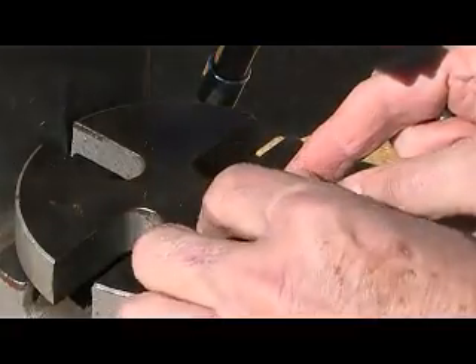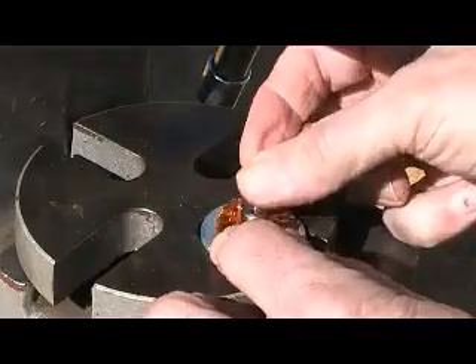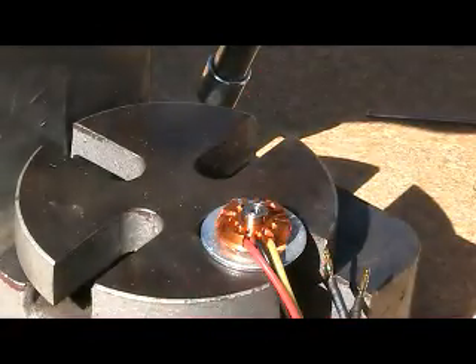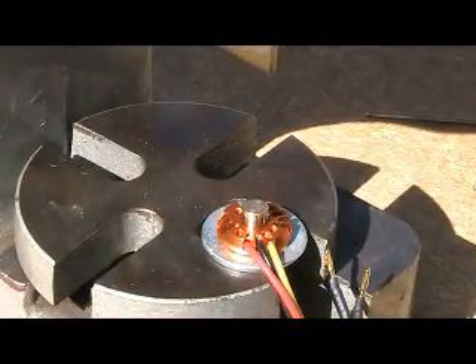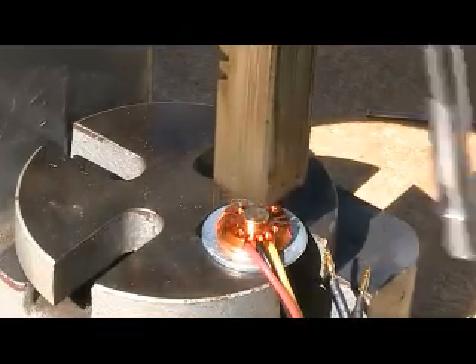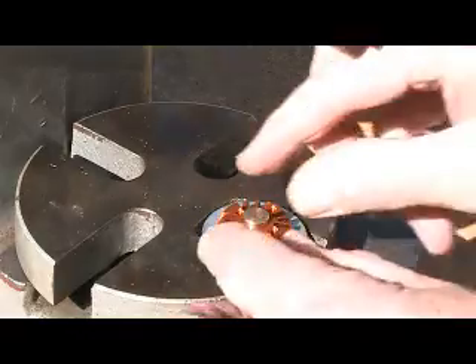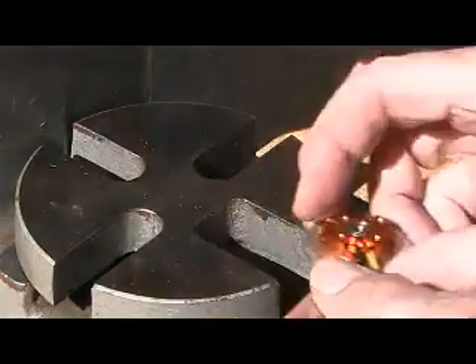Now to reinstall, place the frame on the large washer to receive it, place the bearing in place, get the little pressing adapter and fit that onto the back of the bearing and press it in. There's the bearing sitting back in the frame.